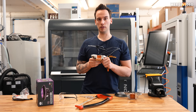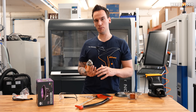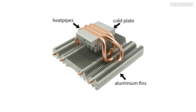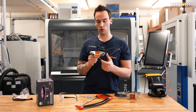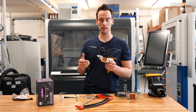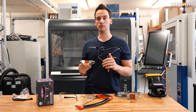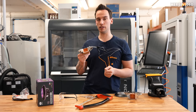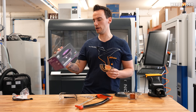The reason you would go for this approach is that you can remove one component. Even the cheapest heat pipe cooler always requires an additional cold plate - a piece of aluminum or copper that sits on your CPU and transfers heat from the CPU to the heat pipes. In this case you don't have that - the cold plate is already the bottom of the huge heat pipe itself. For a budget cooler this probably makes sense because it's only made out of two pieces, compared to the three base components of a standard heat pipe cooler: the cold plate, the heat pipe, and the fins.